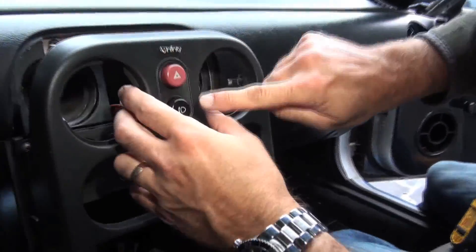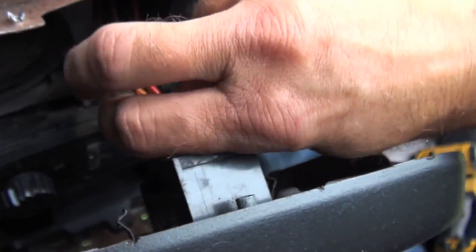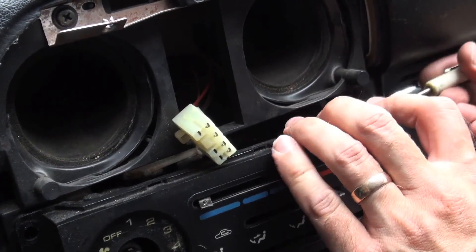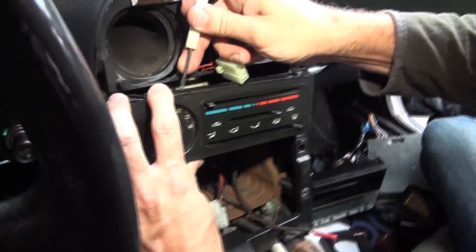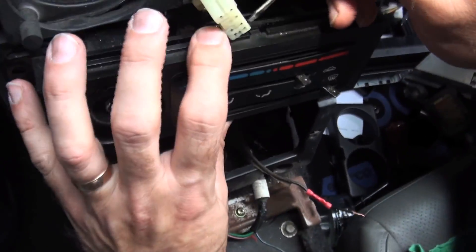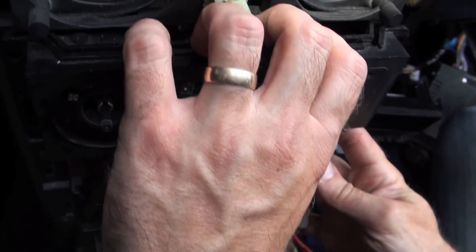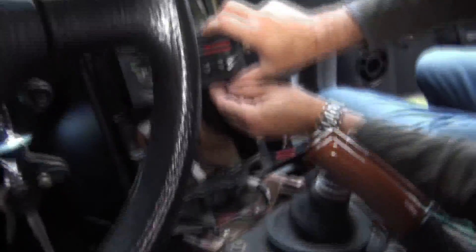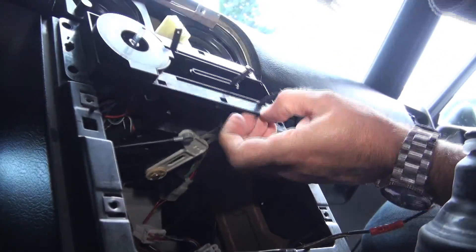In behind here, you have the plug for the hazards and also for the headlight retractor. Just push the little tab in and pull that back, and then this can be taken off. It clips on, so we can carefully pry it apart and push the clips in. Get in behind and carefully push down on these little clips — top three are done. There are three more corresponding clips on the bottom. Just push on them carefully while pulling on the fascia. And voilà, the fascia now comes off.